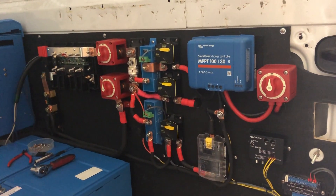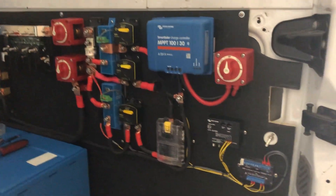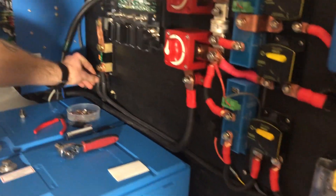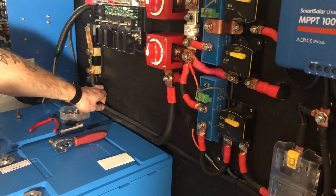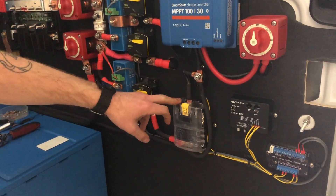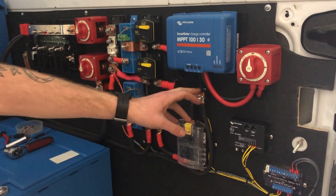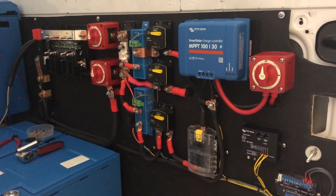For a do-it-yourself installer, you're probably not going to have access to these copper bars — it's really hard to sell such a custom thing. We make them in our shop. They all require a special bend so that there's no pressure on anything. It's pretty time-consuming, but you could do almost the same thing with really short cable connections — a lug, then a really short piece of cable, and another lug to shorten up those gaps. Our kits include all the 4-aught you need, all the lugs and heat shrink you need to make those connections — they're complete kits. You've also made more connections on the junction posts — the chassis connection going up to the load side of the shunt, inverter going to the 4-aught, and a 2-gauge cable coming over to the negative junction post taking the negative feed from the DC distribution.